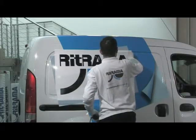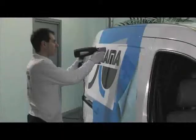Warm up the cast film with a hot air blower, air temperature approximately 393 degrees Fahrenheit, 200 Celsius, at a distance of 0 to 13.78 inches, 0 to 35 centimeters. The adhesive film should be kept at a temperature of approximately 60 degrees Celsius. Shape the film by pressing with a finger into the deepest area inside the drawing using a gloved hand.